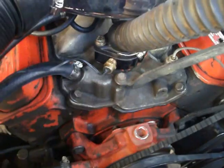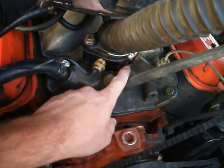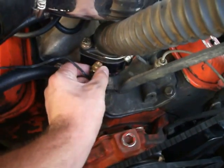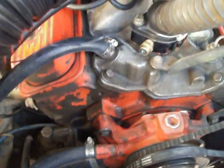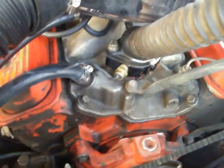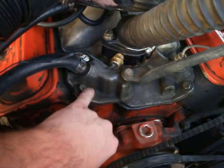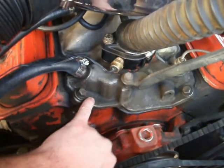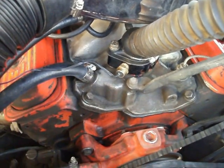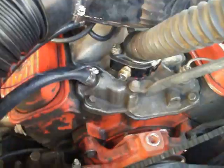There's a thermal probe on the controller. There are ones that poke into your radiator, but I didn't want to poke a giant hole in my radiator. So I bought a one-inch spacer from a website — you just drop it on there and this little probe screws right in and plugs into the controller. Make sure not to tighten it too much because this is an Edelbrock Performer intake and it's aluminum, so the threads aren't exactly the toughest.